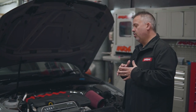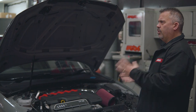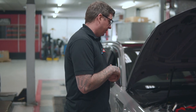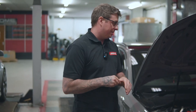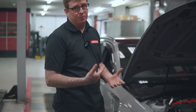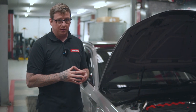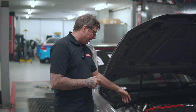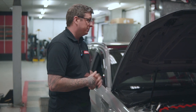The TTE 700s do vary — they run from 585 up to 620 horsepower, and that can all be hardware dependent. One of the worst things for us UK guys — anyone right-hand drive — is because of the location of the brake servo and brake master cylinder, it means our turbo inlet pipe is vastly smaller than on the left-hand drive cars, where the servo and master are on the other side of the vehicle. That allows them to run a much, much larger inlet pipe, which is an advantage over what we have over here.